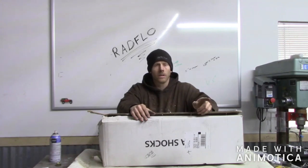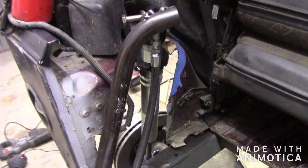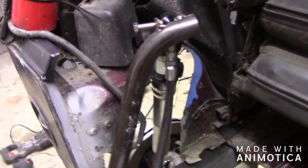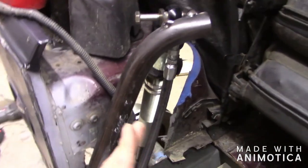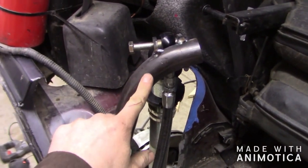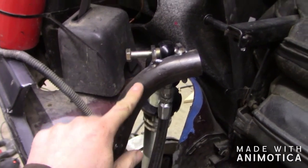We're going to get started. Before we do, make sure you subscribe to this channel, watch the other videos, and hit the thumbs up. One little tip: if you're using a cheaper tube bender like I am that doesn't have degree marks on it, after you get the first one done and you're happy with it, trace it out on a piece of cardboard or on the floor.